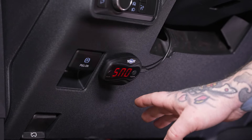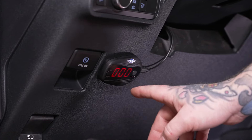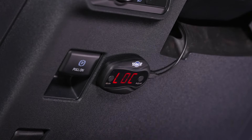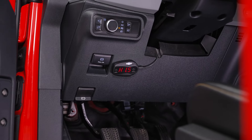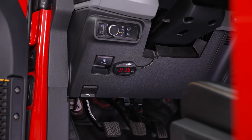Snow, or SN0, is your anti-skid mode. This is suitable for slippery conditions and reduces spin by delaying the throttle response at initial acceleration. When the device displays OOO, this is your intelligent mode, which automatically matches acceleration according to your normal driving habits. LOC is your anti-theft mode, and this eliminates the ability to drive altogether — the throttle pedal will have no response.